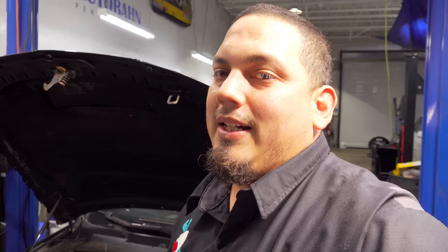There are several ways we can test for a bad ground to the block, there are different symptoms. Some vehicles will have a slow crank, some of them will have a no crank as a result of a bad ground, some of them will only start if you hook up the OBD connection, so that's something to keep in mind. Every system is different. This particular vehicle has a bad engine ground, and we are going to show you a couple of quick things you can do, and a couple of caveats that you need to keep in mind when testing for these things.